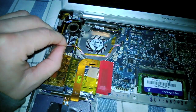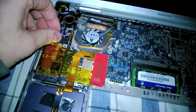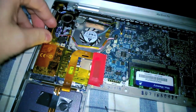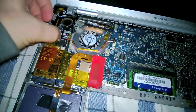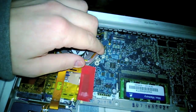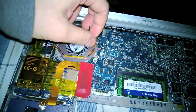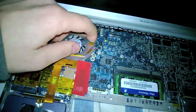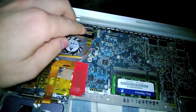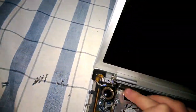Place the light sensor back underneath its transparent lens as I am showing here. The tape goes over the sensor. Reconnect the two wires that run from the sensor and from the fan respectively to the logic board. Reattach the tape. And now it's just a matter of putting the bolts back together to hold the fan against the metal chassis.